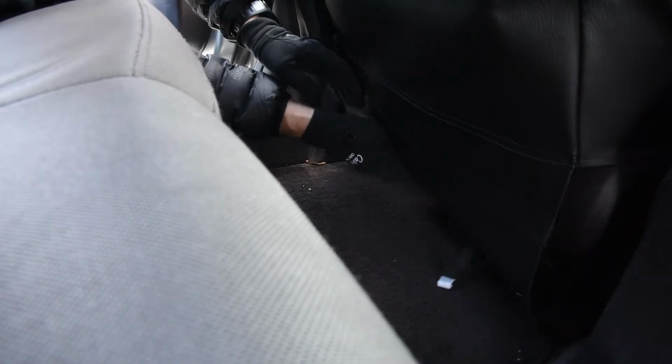There is this flap right here that has these little hooks. Super easy. You just reach underneath and unhook these. They're just hooked onto a spring down there. I'm gonna unhook it now because I need those released to install the bottom seat cover. I'm not gonna completely finish this top seat cover right now, because I'm gonna install the bottom one and then finish this one. This one will just stick to that felt flap right there, and then that goes underneath and pulls in underneath there. But I'm gonna pause there for right now on the backrest, and then we're gonna do the bottom section, because we need to push it through this section right here.